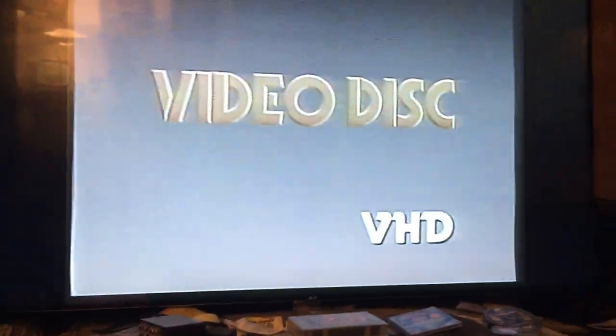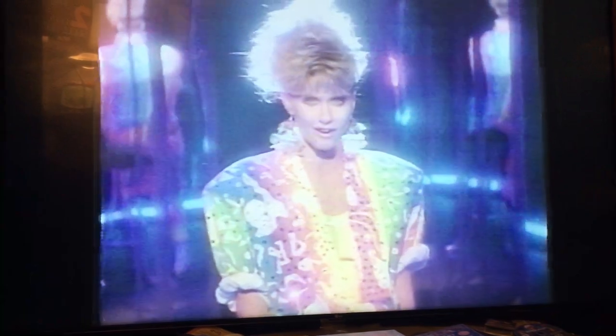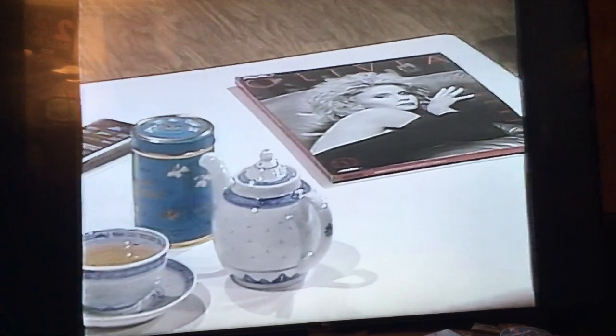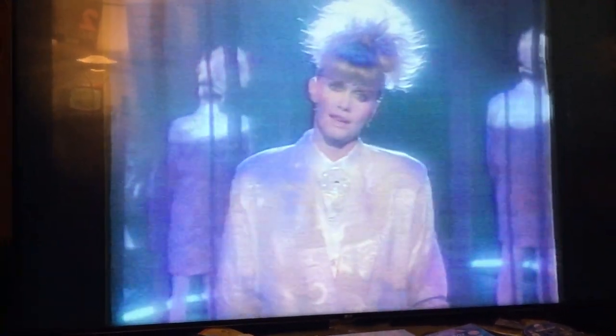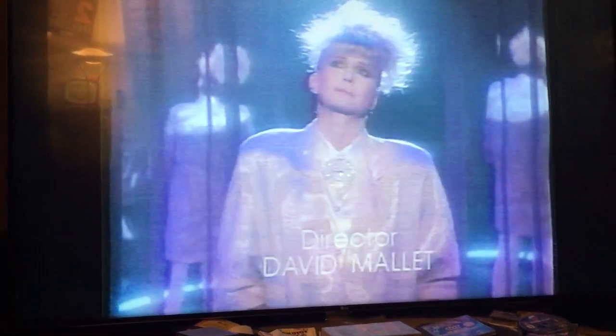Let's go to my TV. It's going through my AV receiver being up-converted to 4K through HDMI. It wasn't doing this before, but sure enough when I have something on camera things are going to go wrong. The picture is shaking a little bit as you can see there. I have five VHD players total right now — the other four are Japanese models — and some discs simply shake like that. They don't do that every time they're played but it seems inherent in the format. Five machines and I cannot get it to completely stop. I don't know what causes it, but if I just let it go that way it will eventually straighten out.